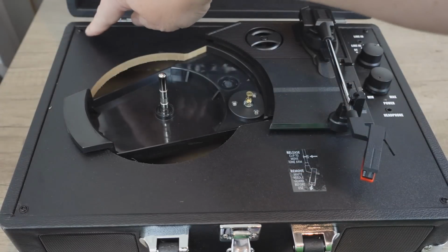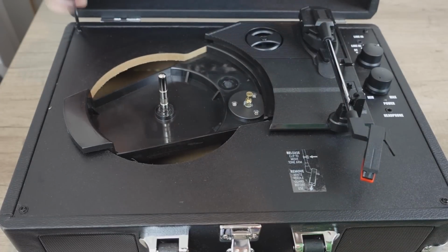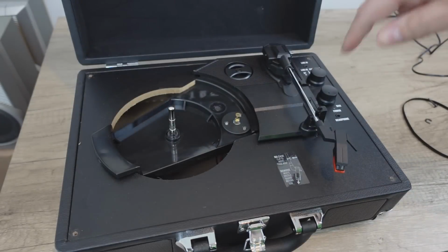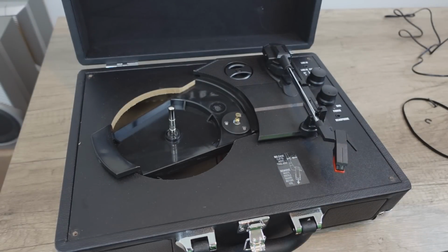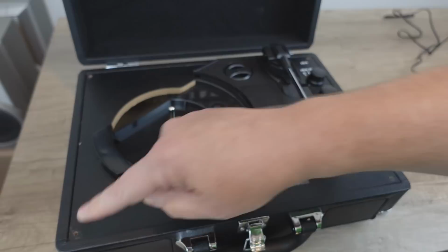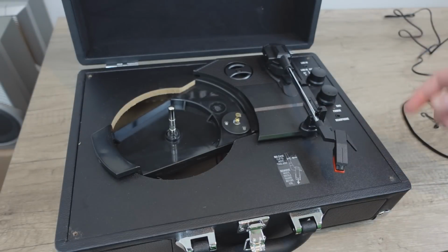So as you can see, the screws on the perimeter are what is going to give us access to the underside. So I'm going to remove these screws and we'll go from there. One thing I want to point out is that the screws that are used are wood screws. These are not machine screws, because most likely these corner supports are just a piece of wood glued in the corner. So sawdust and bits of wood can come out when you're backing these out. They have a tendency to strip out very easily. If that happens, you can always put in some glue or something to firm it up again. But it's not designed to be opened up a ton of times.